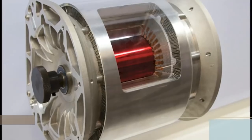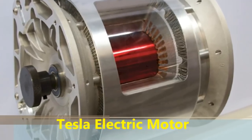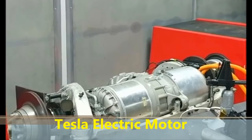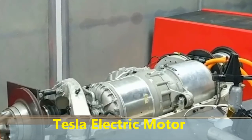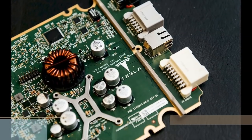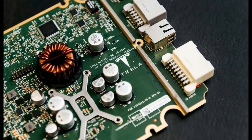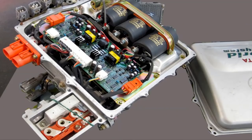We mentioned the Fiat electric and the Nissan — the principle is pretty much the same across all of them. You have a computer and an inverter system that steps up the voltage and makes these things work. In the case of Tesla, there's no stepping up the voltage — the battery itself is high voltage. In the case of the Priuses and similar vehicles, there's something else inside — the battery is charged from the motor itself, which recharges the batteries.